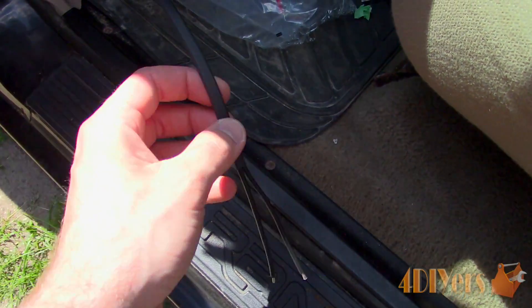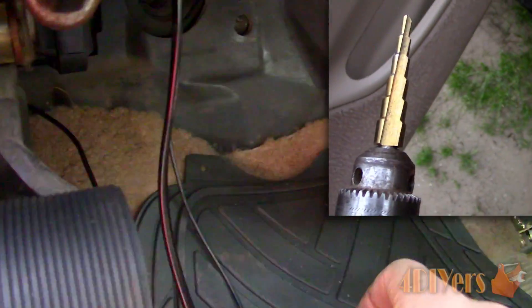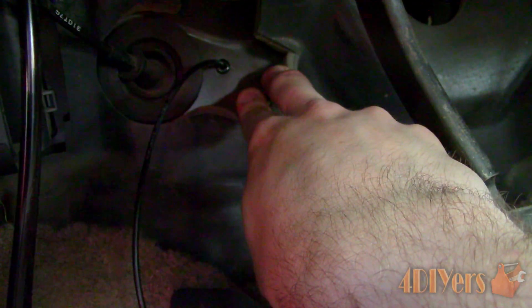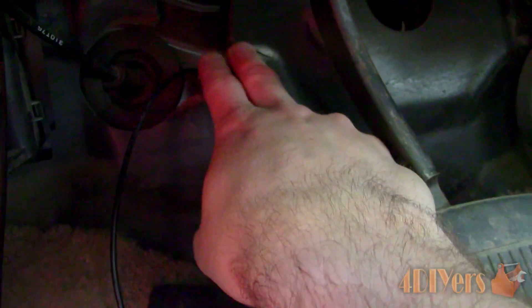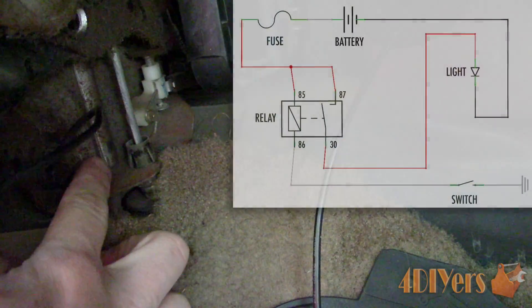To give you a peek of how the wires were run — you can see the entrance through the firewall where I used a step drill to make the hole. Regular drill bits tend to leave a burr in sheet metal, whereas a step drill cuts a clean hole. After that I used a rubber grommet in the hole to prevent the wire from rubbing on bare metal. The opposite side of the switch wire has to be grounded out to the body using an eye terminal, same as what I've made before.